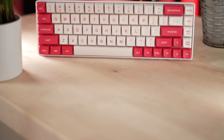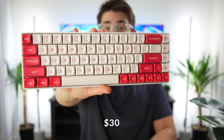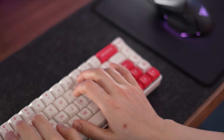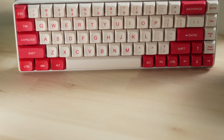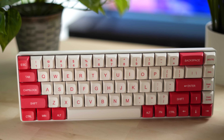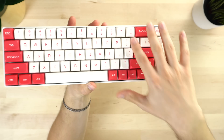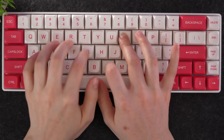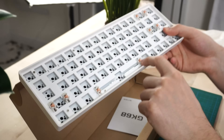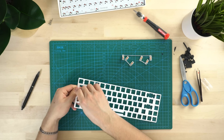Moving on to the number three spot — this is the Tester 68. This comes in at under 30 bucks, making it one of the best keyboards to start modding with. It's super cheap — I got this one for 26 bucks including shipping and tax. Sometimes you see them for 13 bucks, but then it's like 15 bucks for shipping. By the name, it is a 65% form factor — you have what's on a 60% plus those navigation keys. This comes with plate-mounted stabilizers that are not lubed from the factory, which is fantastic — you can start from scratch and lube them yourself. After spending very little time lubing these, they sounded quite good.